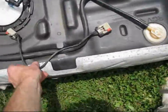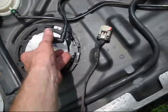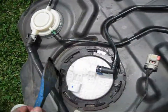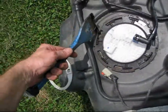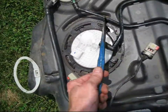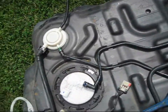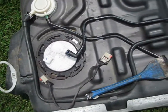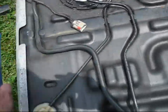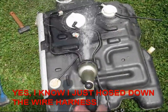The fuel pump is out. Remove the pigtail from the two-month-old Chinese pump and disconnect the fuel line from the pump itself. Then take a mallet and chisel and bang the ring to spin it off — the pump will lift right out. It's also a good time to clean off the top of the tank and use some spark-retardant spray on there.